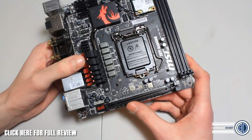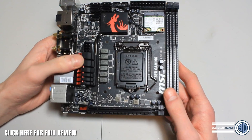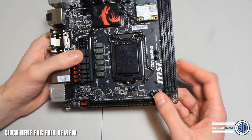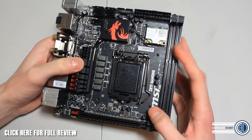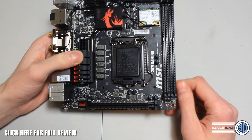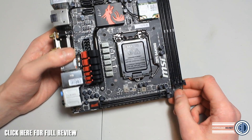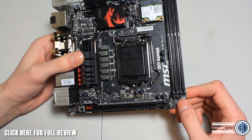Lower down we've got our PCI-E x16 slot. One thing to note is where the processor socket is — it's very close to the edge, and if you're going to be using a third-party cooler you may come into a little bit of trouble, because heat sinks can be very big and it may cause a problem with the bracket. Hopefully, because coolers are getting more compact — Noctua do some very compact slim coolers — you shouldn't have too much trouble finding one that suits.